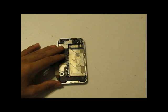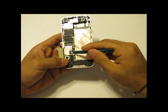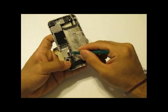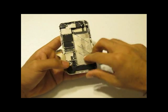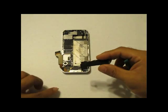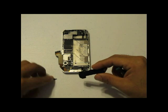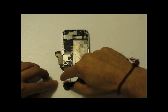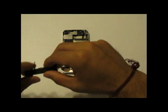Next, to actually pull out the buzzer ringer speaker module, use the safe pry tool and disconnect the little antenna cable held into place. It does wrap around, so once you disconnect it, wrap it around the sides and carefully pull out that buzzer ringer speaker. You will notice a little triangle-shaped object will come out — that goes over the left screw, so make sure you keep it.